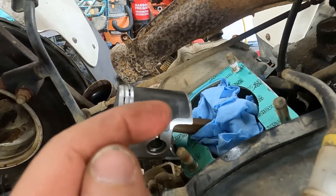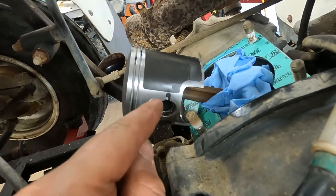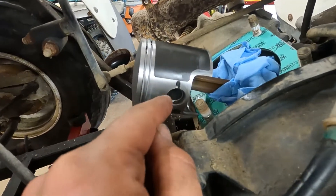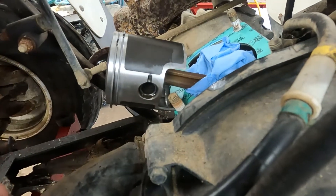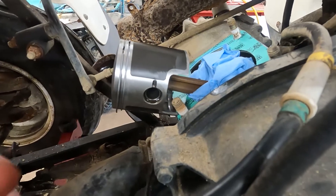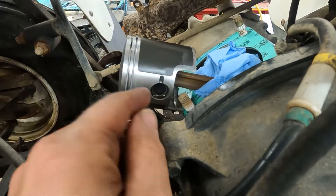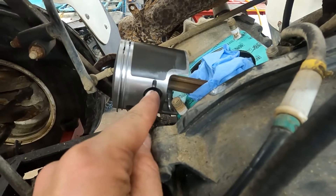I would definitely put paper towels in around the rod so you don't drop the circlip down in there accidentally. I don't really have any tips on getting the circlip in here — I know I'm going to fight getting this in. Just try to make sure it doesn't go down in there and try not to let it fling somewhere into wherever all the 10mm sockets always go because you'll never find it. Make sure you don't bend the circlip. If you end up getting a crease in it and bending it, I would probably just halt the job and order another set of circlips for five bucks or whatever it is. It's not worth the circlip falling out and completely destroying your cylinder — the piston will eat it, or the wrist pin will start to work its way out.